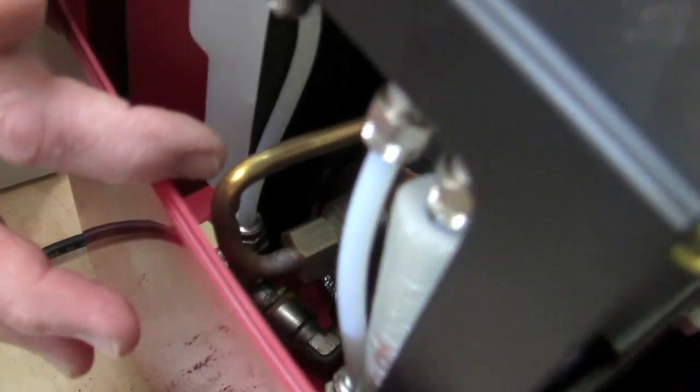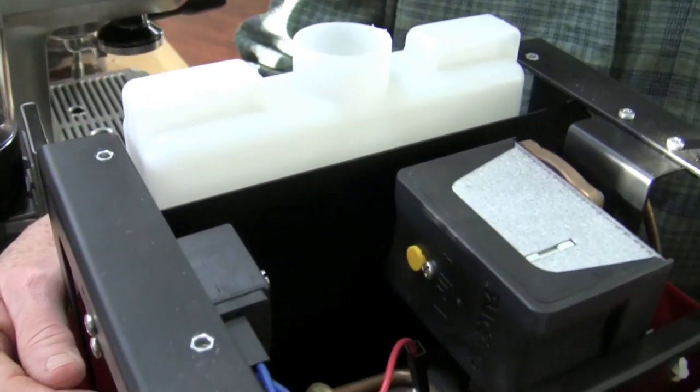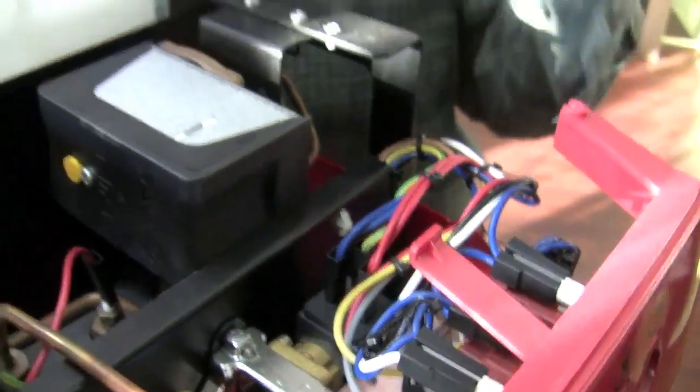Here's how a heat exchanger works: there's a large boiler with a tube running through it. One line goes up to the steam wand, drawing off the top of the boiler where the last quarter is steam. Below that, there's an intake for water coming in from the reservoir, and a separate feed tube for the brew head that passes through the boiler water. By the time that water makes its passage through that hot zone, the proper brew temperature is attained through timing — how long it hangs out in there.